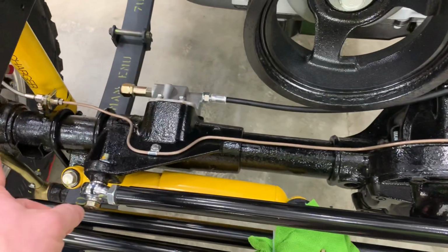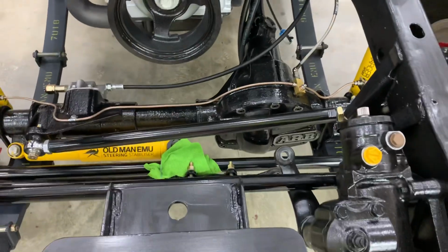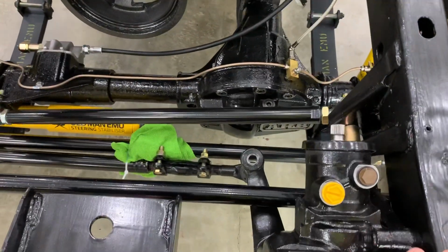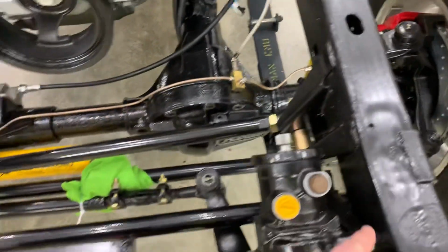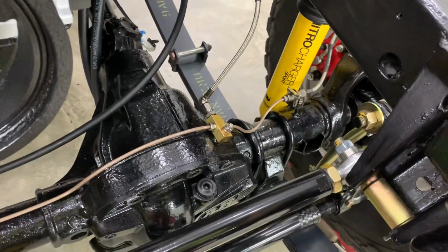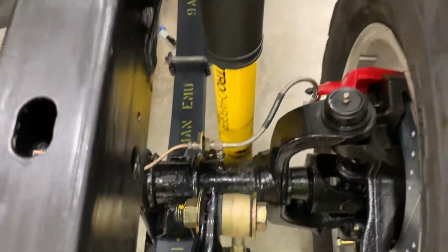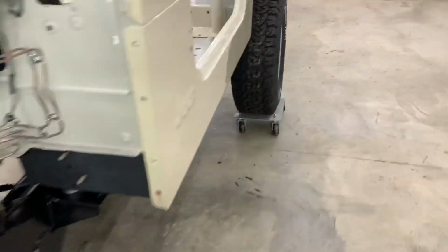And I kind of changed the brake lines around on the front of this because the CJ grill sits down inside the frame rails, so I don't have a means to have a split brake line come up and across like the factory YJ did. So instead, I brought one line down to the center of the rear end, and then 2 hard lines over to a 3AN style connector down to the flexible lines to the calipers. It's a similar setup to what I did in the back.